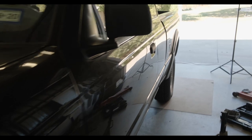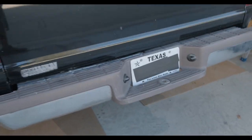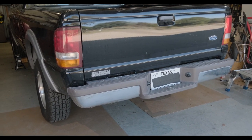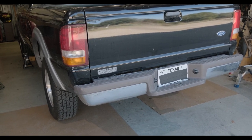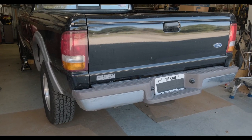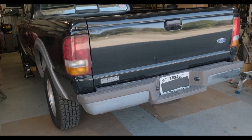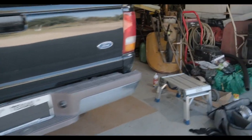So what I decided to do was swap the rear axle out for a Ford Explorer axle. Now this already has the Ford 8.8 rear axle but it has 28 splines. The Ford Explorer axle has 31 splines, which is significantly stronger for any kind of future power upgrades or off-roading, and additionally it gives you full disc brakes all around.